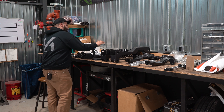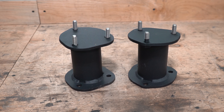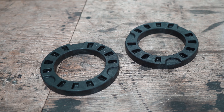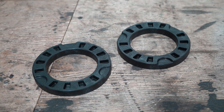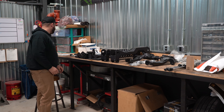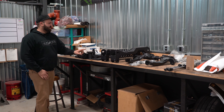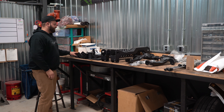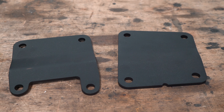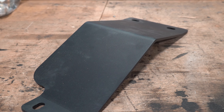No struts on these kits, so we're gonna have the strut spacers up front, and these are gonna go on top of the factory struts. They also make you use a preload spacer, where you'll actually have to take your factory struts apart and then assemble this on top of the spring in the strut assembly to preload the springs to get you that extra little bit of lift. It's only for certain applications that you need to use that. And then obviously we got our diff drop brackets here, and the new skid plate, which is gonna tie in between the new drop cross members when the front diff gets lowered down.